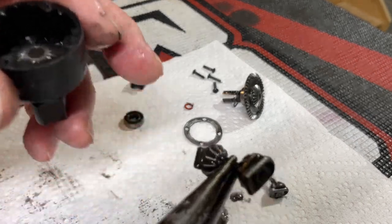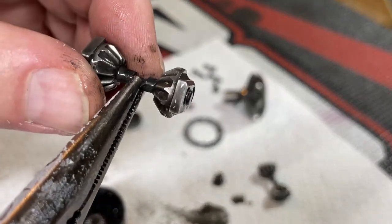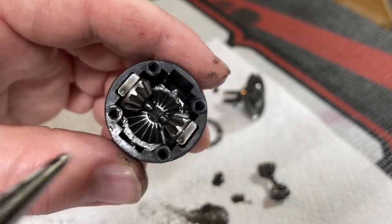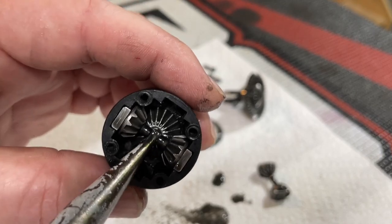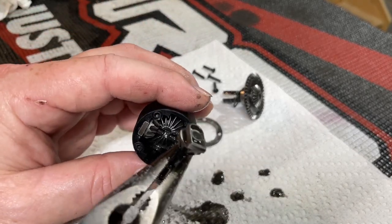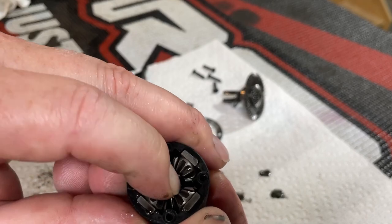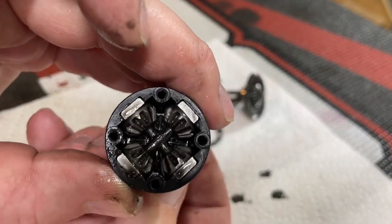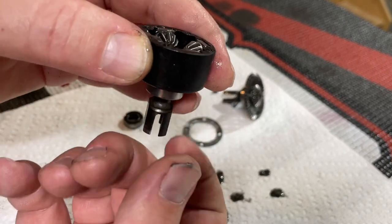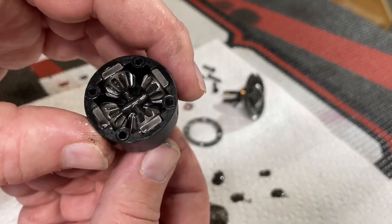There is a direction to these parts — these little half-oval shaped pieces. They do face down, so when putting it back together you want the flat side facing up. Drop those down in there, align the flat spot facing up, then take your other set and drop it on top, wiggle it around and everything will drop back in place. Now everything is turning nice and smooth, and I can get some fresh fluid in here with the new drive cup on the repaired case.